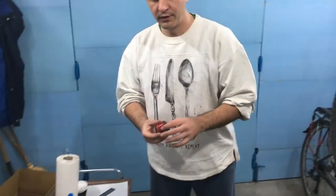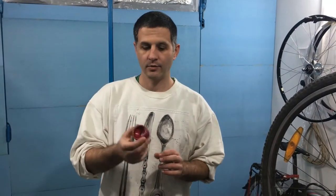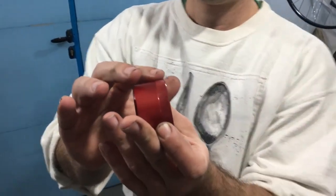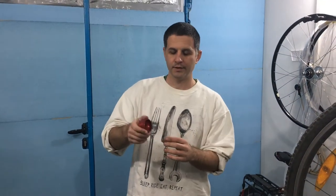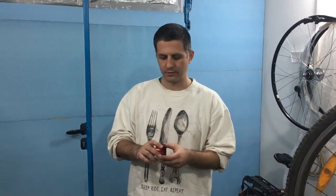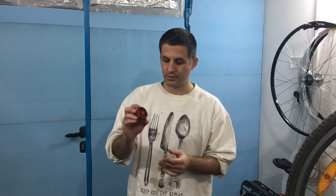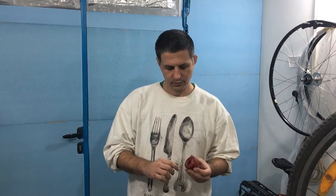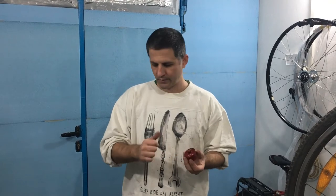Then you dismount it, then back again. These new tools are super convenient — they are very nicely designed and ergonomic, because they have this sort of serration. That serration allows you to easily work using your hands to start tightening in, because the threads are so thin they can be easily cross-threaded if you are not careful. Later on you can use either a ratchet or a bar with a half-inch adapter when you need to unscrew a stuck bottom bracket, so you don't damage the ratcheting mechanism of your ratchet wrench.